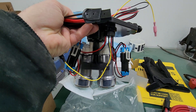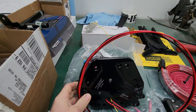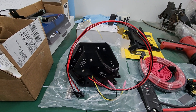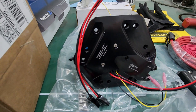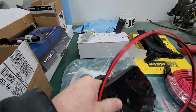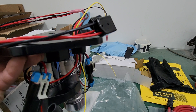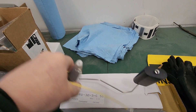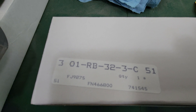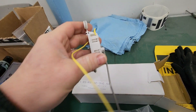We're still going to run all motor with this first and see how it does, because I don't have everything for the supercharger yet. I figured I might as well get the fuel system up and going. This is the dual pump setup — I'm going to be running two 450s. It came pre-assembled, but it doesn't include the fuel level sender, so I had to get one — an 03 Cobra style sender. I got the hookup from Lethal Performance; ordered them and had them shipped out within a few days.